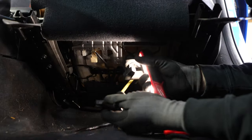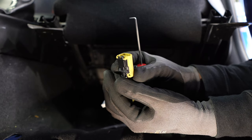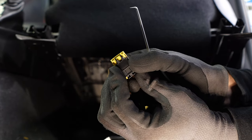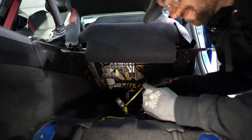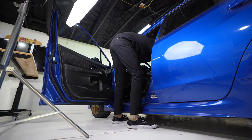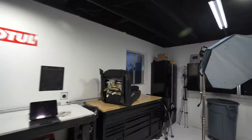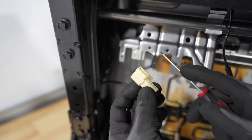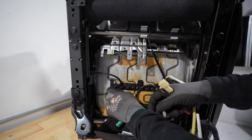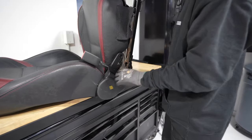Start simple and get more difficult. On this end — the female end of the airbag — this whole piece right here, you push it down and it will release. Next up, that one just has a simple clip you pull out. Now I can pull the whole seat out, which is an art form in itself. I planned ahead with the electrical to have the seat at an angle. To get this plug off, I was able to stick a pick right here while on it, create a gap, and it slid off. Now that's free, you can route it out of here. That wire's free — 14mm. We're done with the stock seat now.